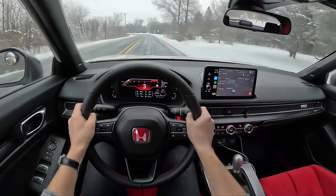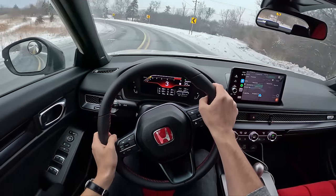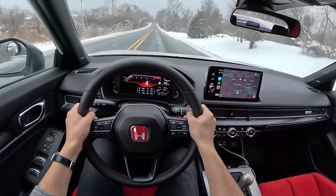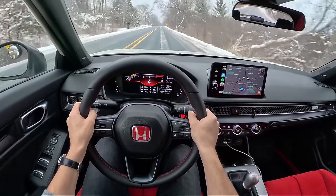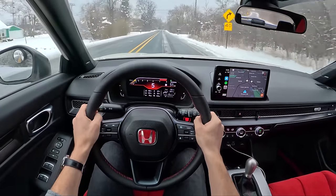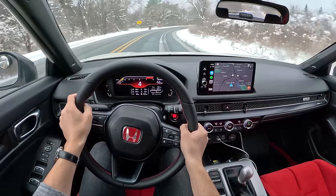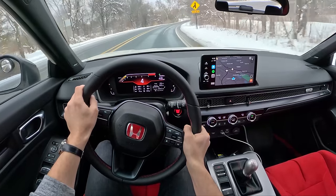So just a little bit of a note on wheel fitment too. I didn't talk much about this at the beginning of the video, but the reason I went with a 50 millimeter offset on these Braids is I didn't want to impact scrub radius and the original dimensions of everything too much. You can go as wide as a 45 millimeter offset on an 18 by 9.5 inch wheel on these Type Rs, and that's kind of perfect flush fitment with the fender. You should probably be able to squeeze a 265/40 under there, but the standard size would be a 265/35 R18. And that'll look pretty sharp.